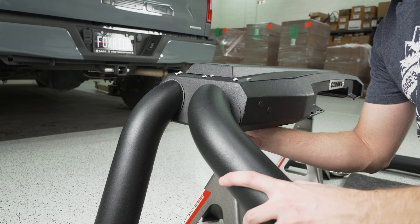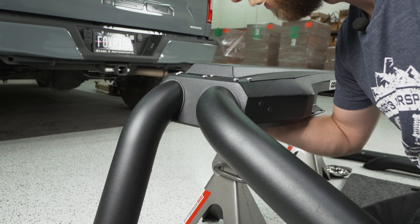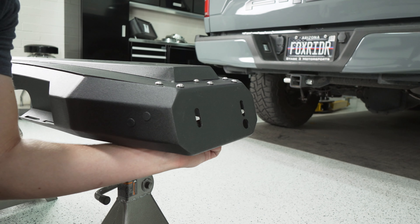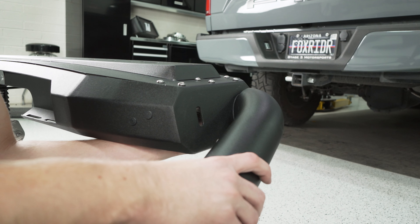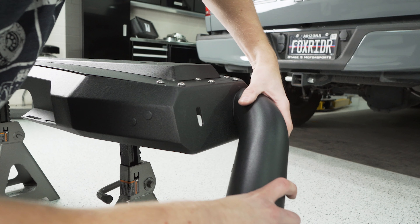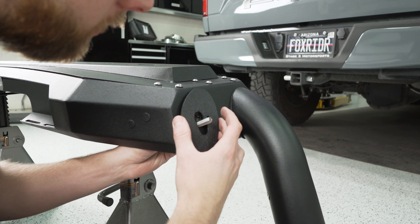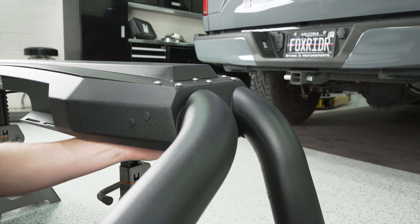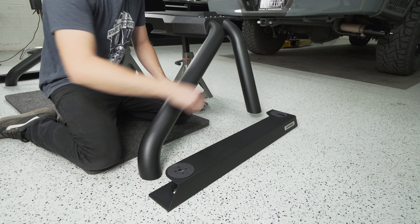For the hardware, you're going to have a hex head bolt, as well as a lock washer and a regular washer. Bring it through the slot in the back and set your plastic cap over the top of that. The arm itself has a threaded insert in there, so we can just get this on by hand. For now, just leave it hand tight so there's still some rotational room — we'll go back later and lock it down once we have everything squared up. You don't want to tighten this first and not be able to fit the rest of the brackets. Now do the same thing for the back bar, and then do the same thing on the other side.